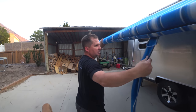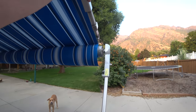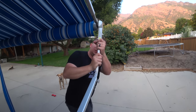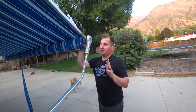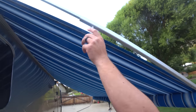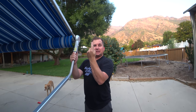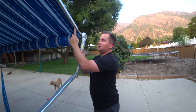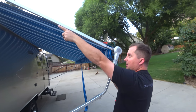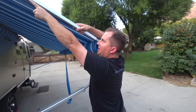You can hold it here, have an assistant hold that, or just hold it here. Pull this up and put the little hook right in there. It's still not quite holding itself — if I let go, it's going to start pulling up. Here's the only tricky part: throughout this whole awning, we've got these little spring-loaded pins. Those pins pop into the little detents and hold the tension where we need it. This is spring-loaded — I need to pull this, get my pin clicked in, and then this side will be locked. There — that just clicked in.